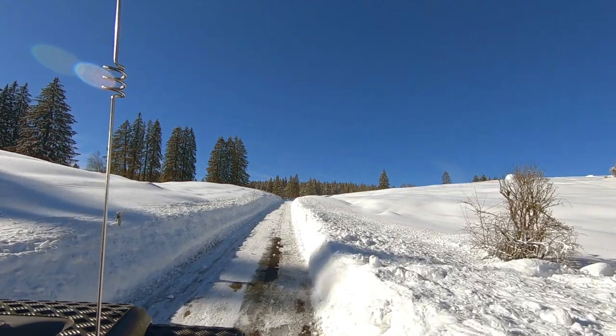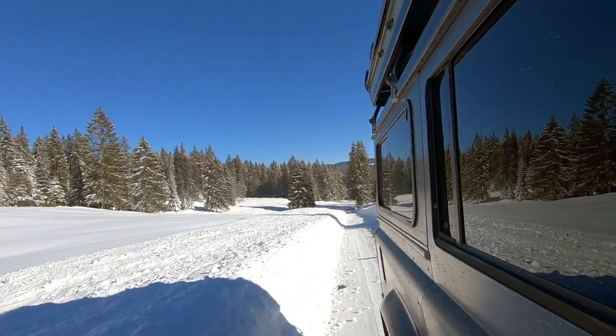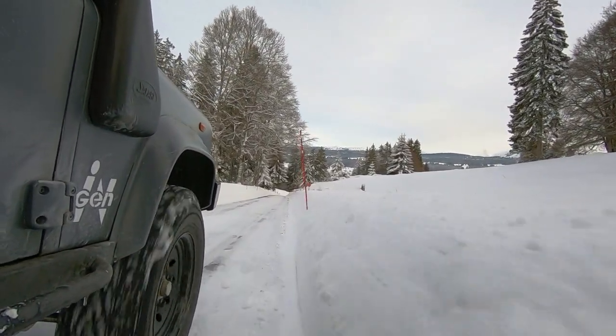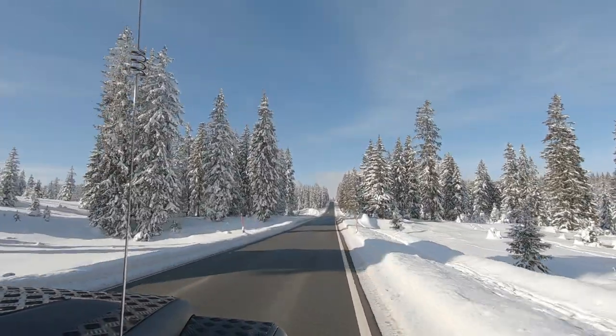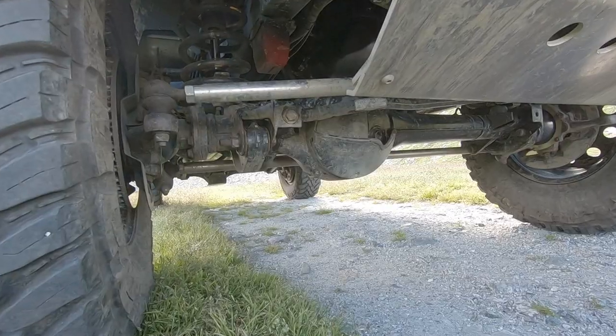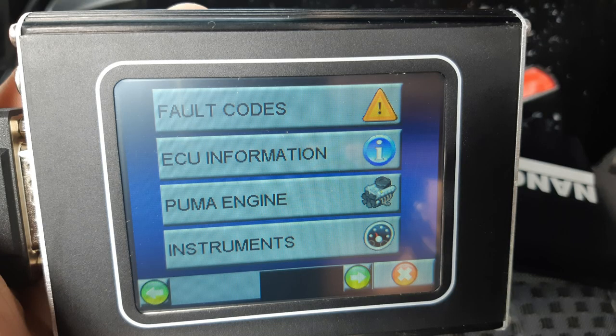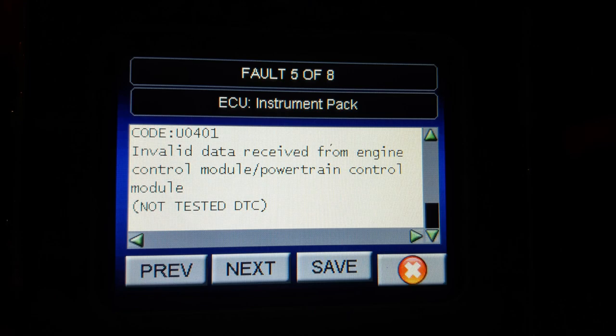Let's say it, this only works in a perfect world. It also happens that this electronic control unit is wrong and a failure is taken as such, when in fact physically there's no mechanical problem. Or even worse, the opposite situation, a real failure that wouldn't be detected by the ECU and would lead to a real breakdown. These various mistakes can be due to sensor issues, or simply a failure in the electronics hardware or software. As always, it's best to know your vehicle mechanically to be able to translate the information delivered by the ECU and then be able to judge whether or not it's in line with reality.